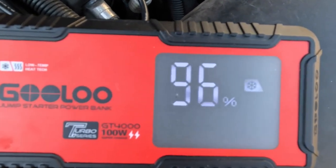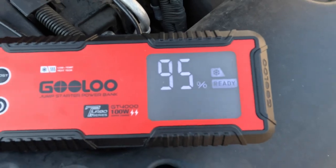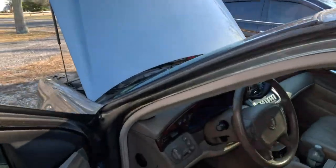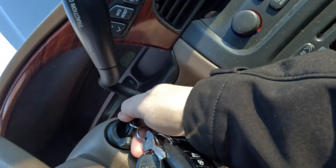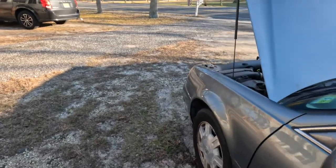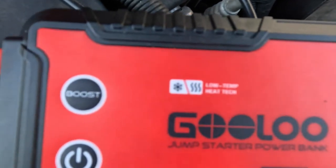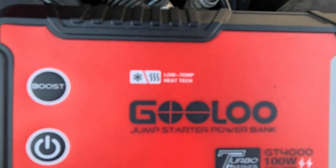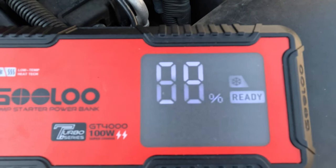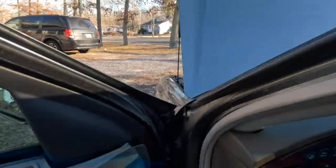Let's hit the boost button anyway and see if it'll jump start now — probably not. I can hear it chiming. It's clicking — it gave some power. Keep in mind, when you hit the boost button you're just disabling the security features. This is the GT4000; snowflake is still there. Hit boost one more time — it says ready. You're supposed to wait for the snowflake icon to disappear before jump starting, but I am impatient.